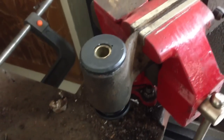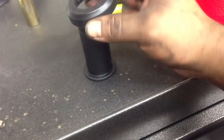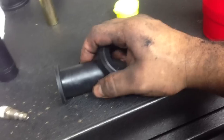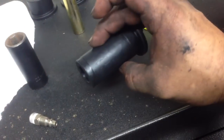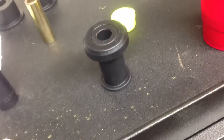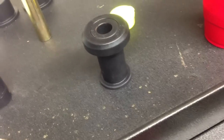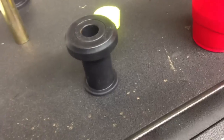That pretty much sums it up for the spring bushing — the other side is the same way. This kit also came with the frame bushings for the frame. It's a one-piece bushing with an end cap, which they call a thrust washer. It installs in the frame this way for the driver's side and the other way for the passenger side. Just knock out the center metal sleeve, cut the rubber out — you can actually keep the metal sleeve on the frame, which makes it easier. Then press the new bushing in basically by hand or with a light hammer. Pretty much that's it — you're done.